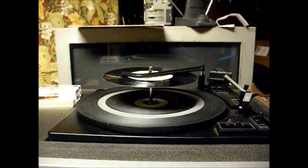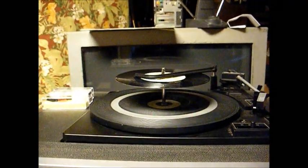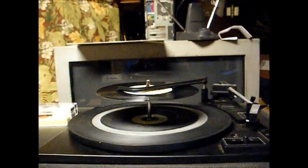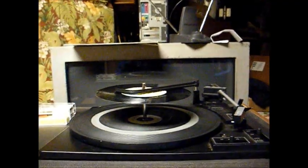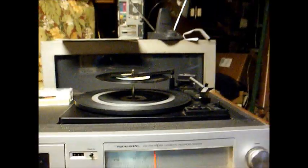Here's the third cartridge. I have not reversed the wires yet, but it's not going to have any effect on whether it skips or not. Once I determine that it's okay, then I'll reverse the wires. I think that did it — or at least it's a lot better anyway. It's not skipping and I'm not detecting any distortion, and I haven't reversed the wires yet either.